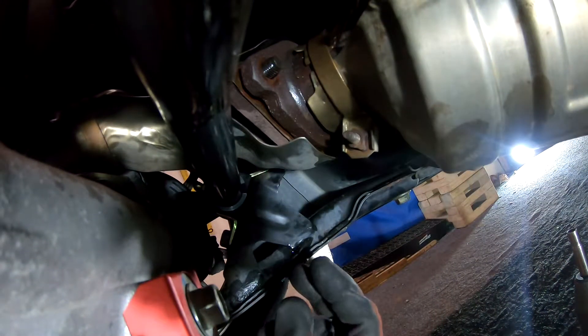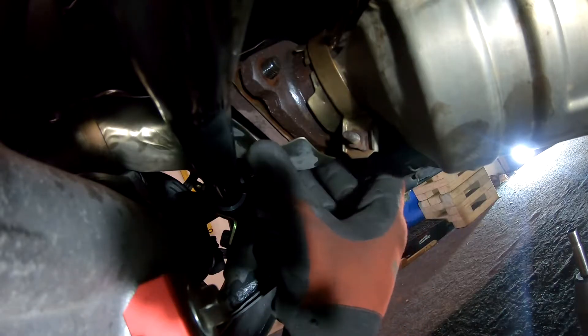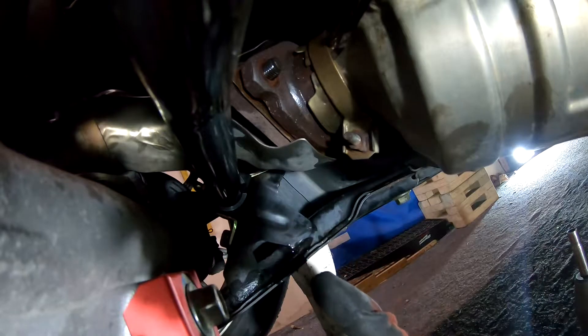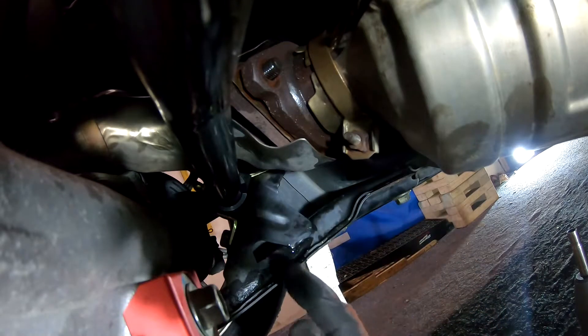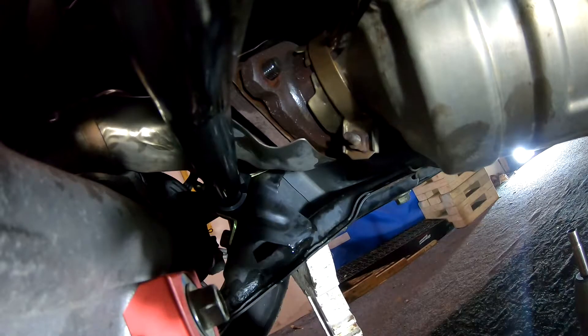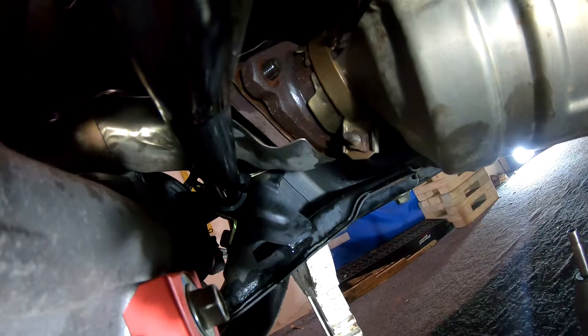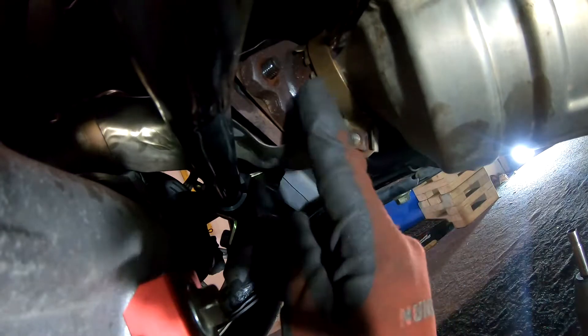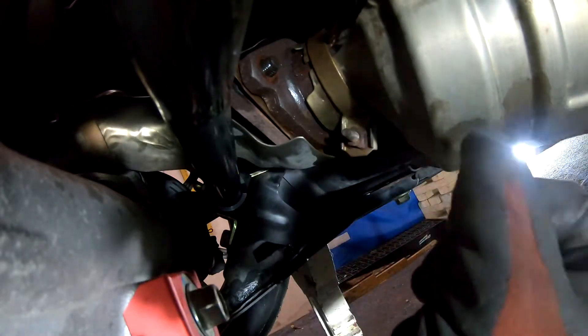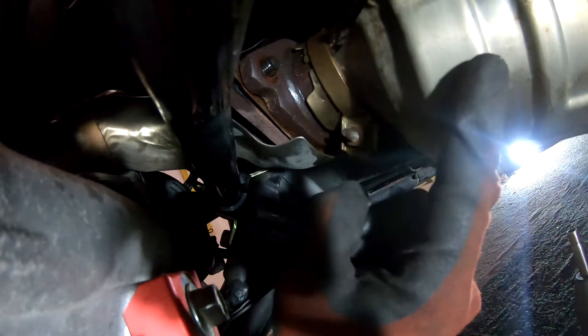I got my hardware out and this is the pain-in-the-butt part. You can see there's not much room to take the uppipe out because it's going over the sway bar, the steering rack, and the subframe. And this has studs on it which makes it even harder. So I think I am going to have to drop this to get it out of the way.